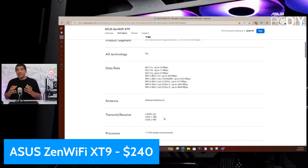That one band is generally very stable, has very good speed and very good throughput, but that's why traditional routers tend to perform even better, because they are not sacrificing one of the bands to talk to another router. But they may not offer broad coverage in the same way that a mesh router could, because those mesh routers work together to provide more coverage, but maybe at the expense of some performance. So being able to have flexibility in terms of that backhaul gives you the best of both worlds, right? And the more bands you have, even if you lose a band, you're still able to maintain 2 bands for your devices. That 2.4 gives you the best range and very good performance, and then the 5 generally gives you less range, but higher speeds.